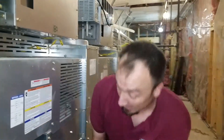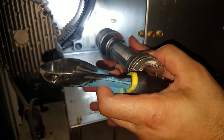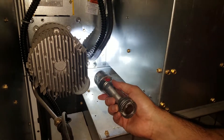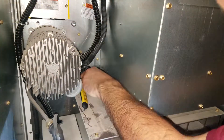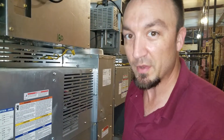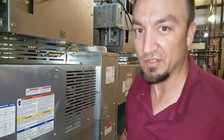Now we're behind the dryer. Go ahead and look into where the tubing is coming out through the rear. I've already pulled the screws out of the bracket here. There is one zip tie that's connected holding all these tubings together — I'm going to go ahead and cut this. Now that the zip tie's cut, we're going to remove the tubing from the bracket. You can just leave the bracket off because it really has no use after this.